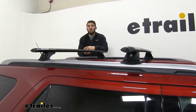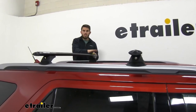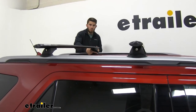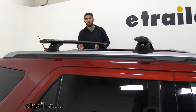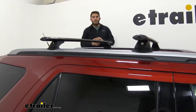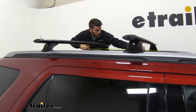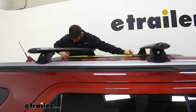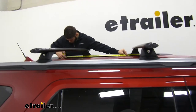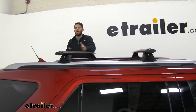There's actually another mounting point on our roof where we can mount the second crossbar — we have these points right here, but we could also scoot it back to this point right here. That would extend the crossbar spread, and if you have an accessory that requires a really large crossbar spread, moving back to that position gives you about 39 and 1/4 inches.